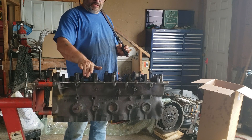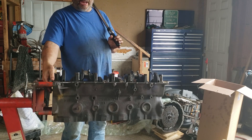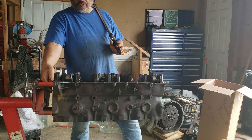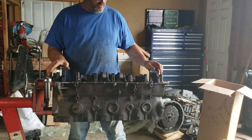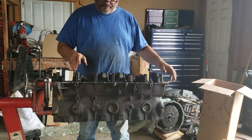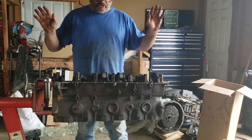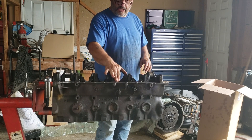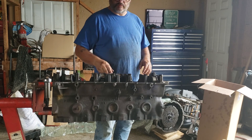Start in the middle and work your way out towards the ends. The last thing is to rotate the crankshaft and check for binding — it should roll pretty easy. In this case where the crank is a little worn, if it was a new or machined crank with oversized bearings it would be a little tighter. You can also check for end play — if you're hearing a clunk, you've got to do some work on the thrust bearing. We're doing a budget build — it's not binding, it rolls beautifully, a lot better than it did before.